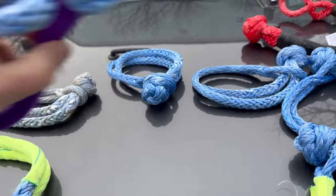So here's my setup: I've got a snatch strap with some stretch to it around a massive tree, and all my soft shackles daisy-chained together. The important thing is once you've opened the loop and put the button knot through, it's cinched down and those two pieces are even so that knot is cinched down in that loop as best it can be. I'm going to tighten them one way, then take the loop off the button knot, flip it around the other way, and tighten the knot the other direction. You can see how much smaller that knot is and how it's got tension from being used — it's just really strong stuff, that knot is definitely tighter.